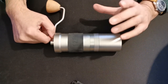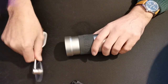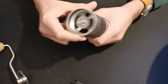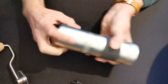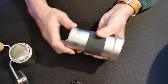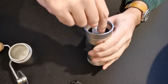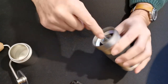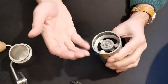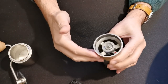It's not difficult but it would be easy to get it in the wrong order. So obviously you take the handle off and unscrew the bean hopper. Before you can undo anything else, find out how many turns until the burrs can't be moved with the handle. On this grinder it's two turns, so you know to come back two turns to get back to espresso.